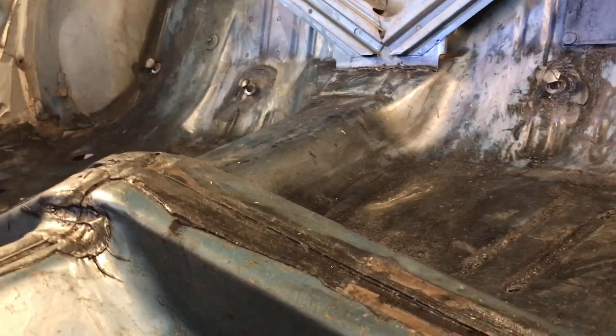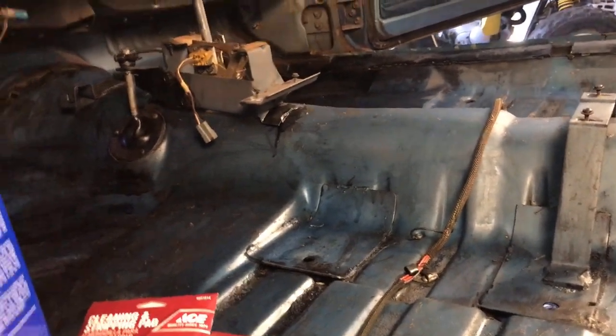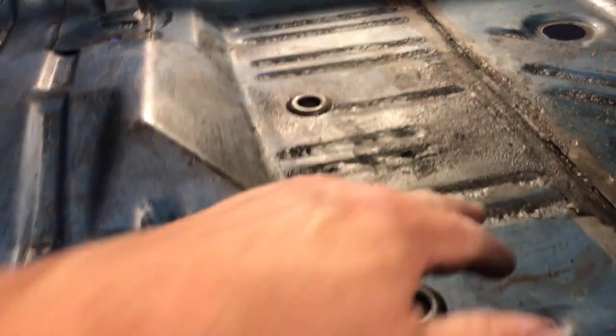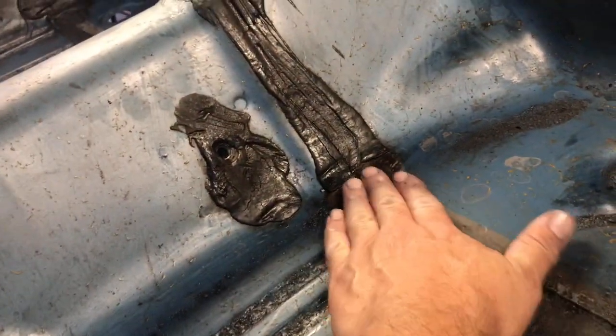So I'm still leaning towards going ahead and just spraying some clear coat in a rattle can over the top of all of this so that it's sort of sealed. We've got no rust now. It's all been converted, and where there's paint, even if the paint is thin, it'll get sealed with the clear coat. Some of this stuff, like the seam seal, broke off and exposed the metal. So putting a clear coat over it will seal that up, and I think it looks pretty good.